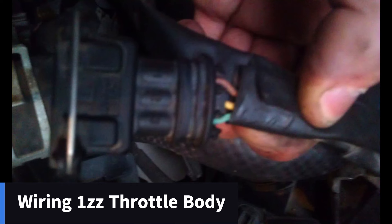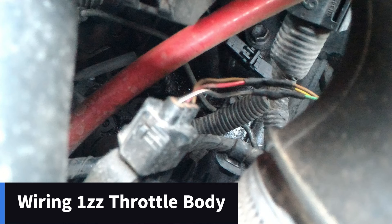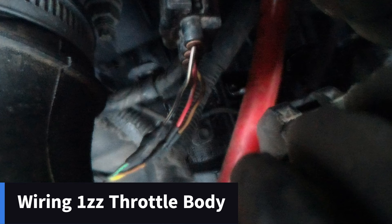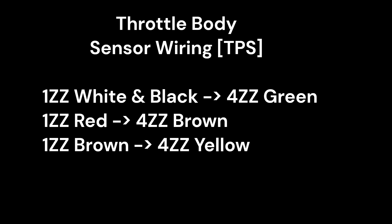At this step you're also going to want to add your throttle position sensor — this is a little bit of a tricky part of the installation. I have the wiring scheme here for the 4ZZ; the 3ZZ you should be able to find online on forums quite easily. If you mess this up, you can really cause yourself a headache. I inverted the throttle position sensor on mine, which meant that when my foot was flat out on the pedal, the ECU was reading it as idling — and when idling, it read flat pedal. I ended up with all sorts of idling and fuel consumption issues. For the 4ZZ E11, the wiring diagram I've figured out is: white and black wire going to green, and red wire going to brown.